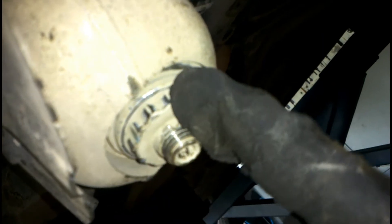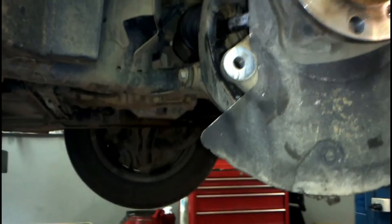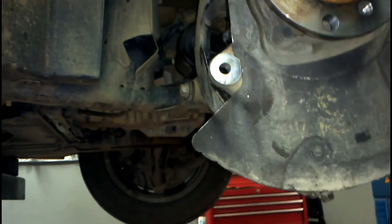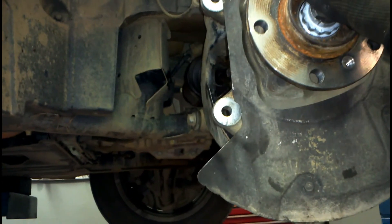When you're tightening up these ball joint nuts, sometimes you can get them to just tighten up as they are. If you can't, you'll need a 27mm double hex ring spanner and the same Allen key that you use to take the disc brake off — get one in the other and hold the ball joint while you tighten up the nut. I'm going to chuck the brakes back on and the wheels back on, tighten up that suspension component and the covers back on, and we're done. If you have any questions or comments, or you want me to do any DIYs for you specifically, let me know in the comments section below. I'll check you next time on BM Trouble U.